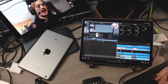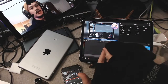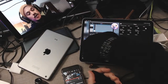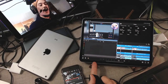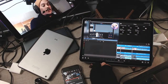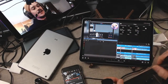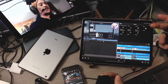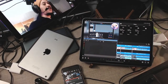Now, the easiest way to do it is to use a suction cup. You push down a suction cup, and then you start pulling it until you can get something in under the screen, and then you start fiddling with it, and you basically just try to loosen up the screen, keep heating it and loosening up the screen, keep heating it until it's loose. And once it's loose, you got to deal with cables and stuff, and there are so many ways that you can break things in here.